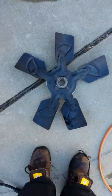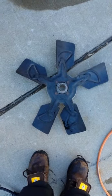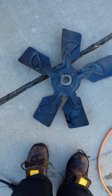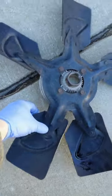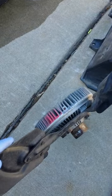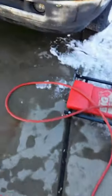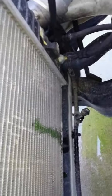The fan is not like a regular fan like you'd have in your house — it's got gaps. So when you're working on this, always make sure the wide gap end is up so you can get your wrench in there a little easier. Also, make sure you hold on to that fan during the last couple of threads or else you'll nick the radiator — and it's a brand new radiator too. That sucks.